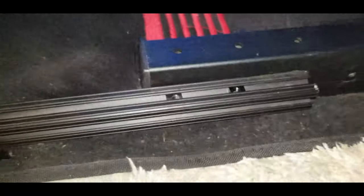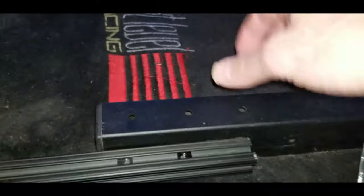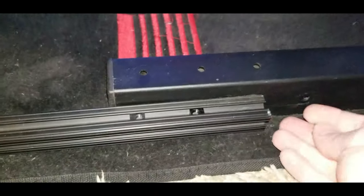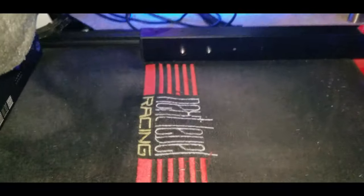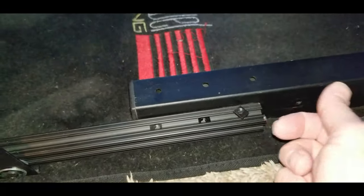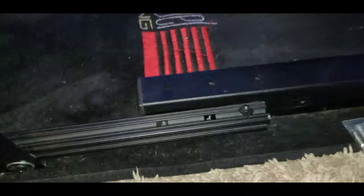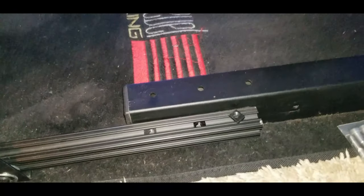When you were using the old square tube, you had to completely remove the bolt from the unit just to make forward and backward adjustments — that becomes a pain. That goes away with the 10-series. All you do is use those two pre-drilled inner holes that are already there, throw the one-and-seven-eighths bolt through, drop the little tab into the channel, screw it down, and you're done. When you want to adjust forward or backward, just loosen them slightly, slide the unit, and tighten down another quarter turn.